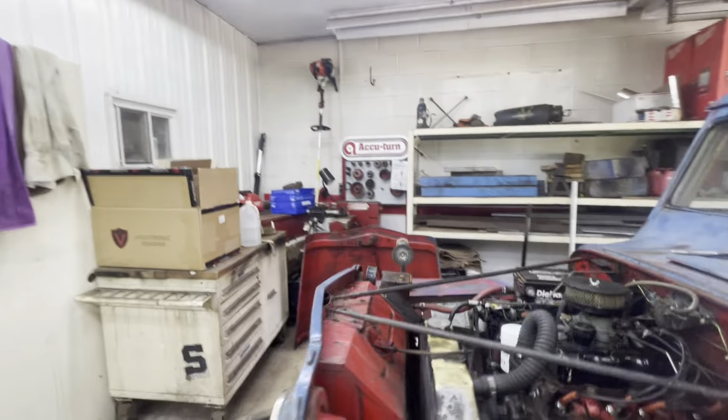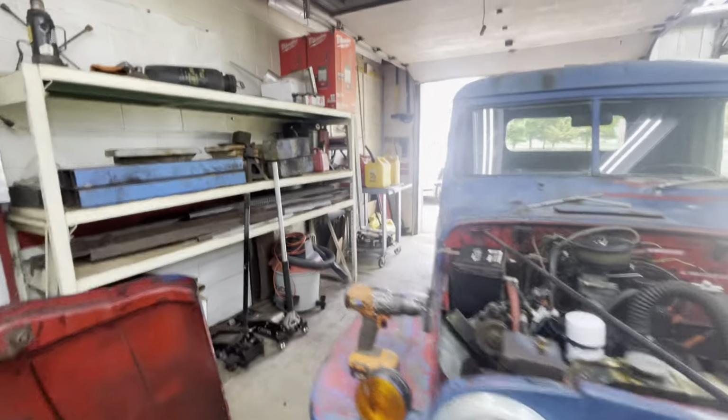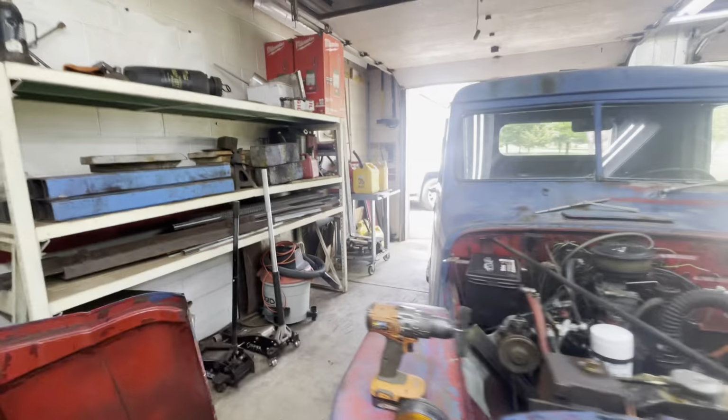Windshield's good there. On this side, this window was really messed up, to where I almost needed it replaced, but also this one too. So bring it up. We also got this cleaned up. A few tricks we did was get a cloth, a towel, and dip it in white vinegar, and then just let it rest on here for about half an hour, the whole width resting as we go to other projects.